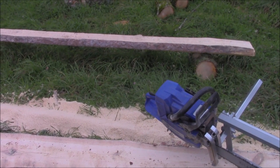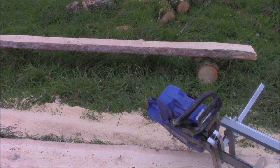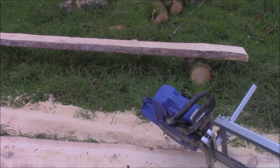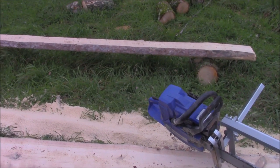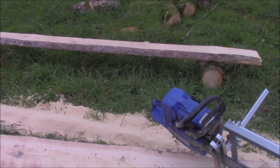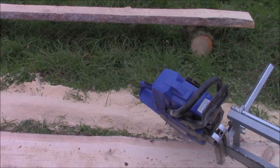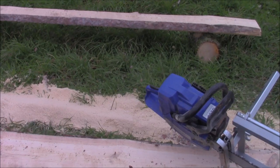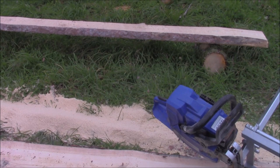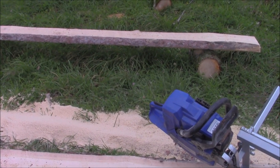But the cooling system and the internal components of the saw are going to get to some steady state where it's going to operate at a temperature based on the efficiency of the burn, how much gas in there is in fact being burned, and also how capable the saw is of removing the excess heat. Now, if the cooling system can't handle the amount of heat that's generated by that saw, right? Some of it goes into motion, but some of it has to get blown away by the cooling system, the fan. Well, then things begin to increase in temperature until they stop, right?